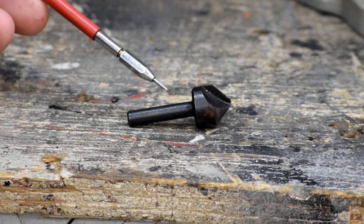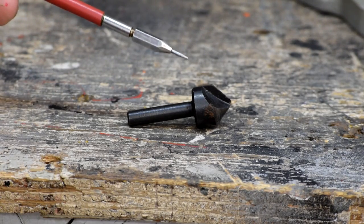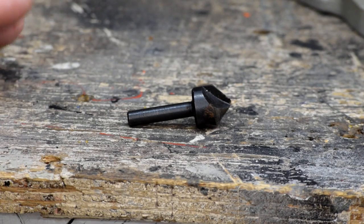Here's another little finishing trick: I just hit all the bolt holes in the manifolds with this countersink to deburr the entrance of the bolt holes. Cleans it up, makes it look nice, and gets rid of any sharp edges that might interfere with the bolt.